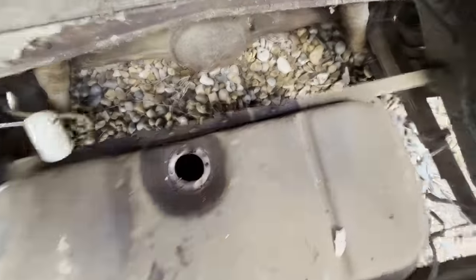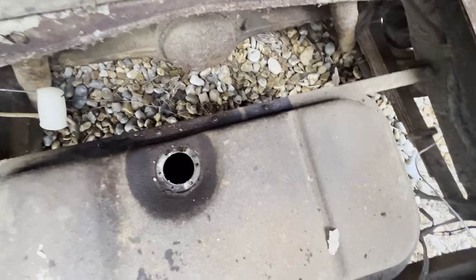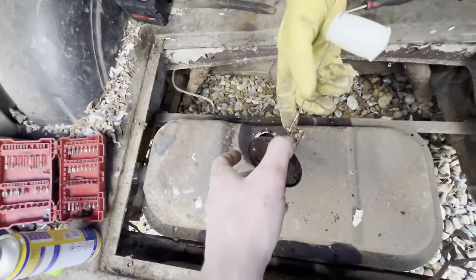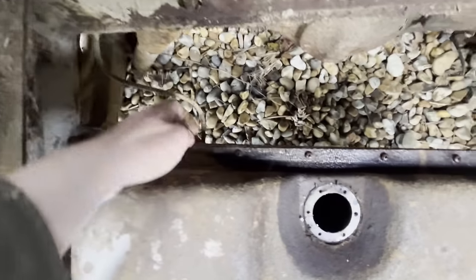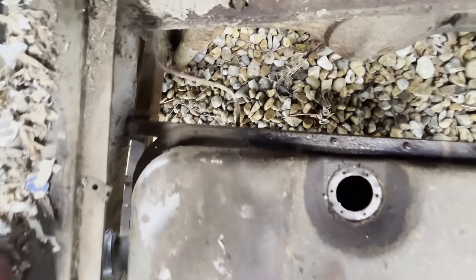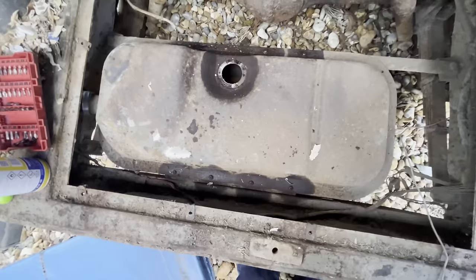So next thing, we'll try and get this line of screws off. They're nutted from underneath. This one, take my bit of hose that we cobbled on last time, and then the whole lot should pull out. Oh, and of course the solid steel fuel line. It's got just like a hydraulic fitting on there. Take that out, we should be good to go.